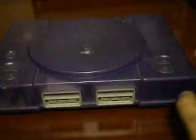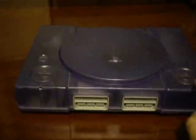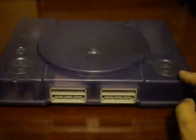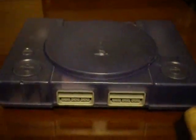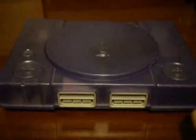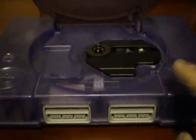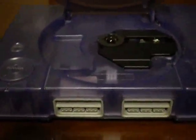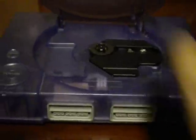The first one was a pretty easy thing to do. They usually sell these shells at game stores for the old PlayStation. I had one of these lying around, and if you recall, the PlayStation I found for $3.99 could play both Japanese and English games. I basically moved that system over here and replaced the eye as well. I had a system in this one so I just swapped out the motherboard instead of doing all the soldering again. Now it's modded inside and out, which is pretty cool.